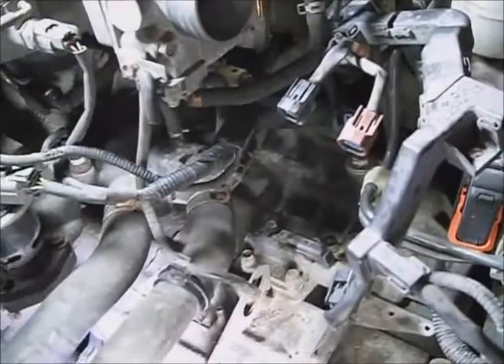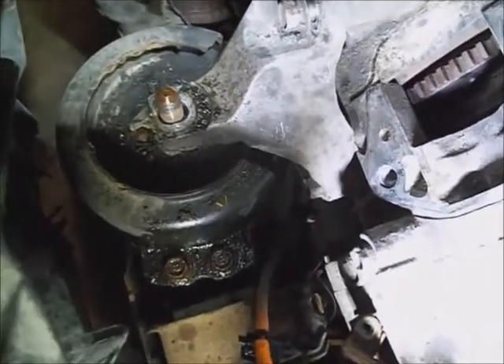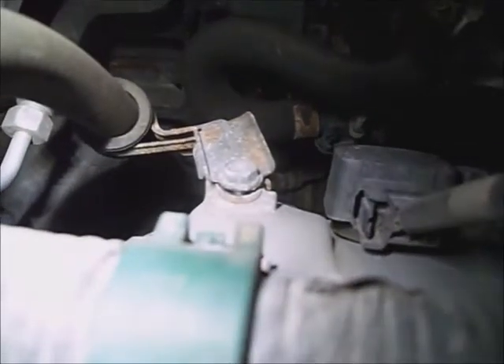I think my business up here is about done. I went ahead and loosened the upper 14mm bolt on the front mount — it's actually bolted to the engine and has a leg that bolts to the transmission directly behind the front lower mount. I'll just want that bracket hanging loosely. I'm going to go over to the power steering high pressure line and at least take the clamp loose on the valve pin cover securing it, to get some flexibility out of the hose — I may have to end up removing the two bolts holding the pipe down to the pump.